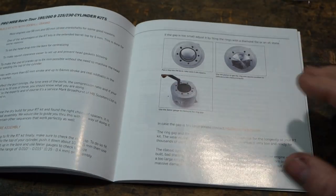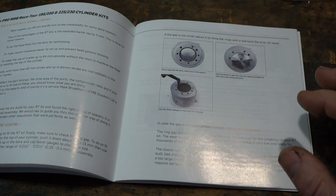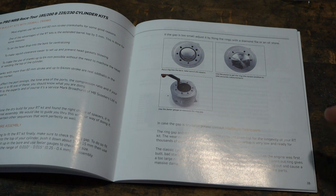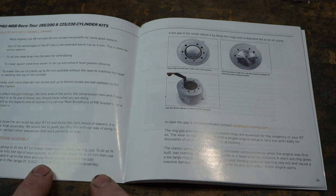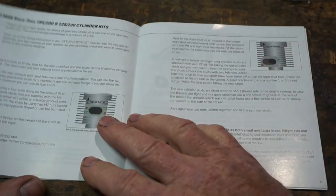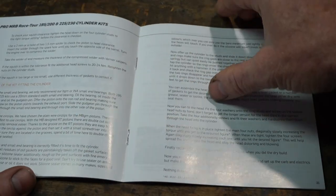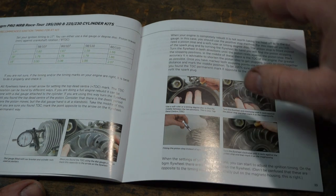There are other explanations for different combinations here — 110mm rod, 60mm stroke with the 107mm rod — all trying to keep the ports as low as possible. And then it comes to a little explanation on how to do your ring gap. Simply put the rings into the bore, push them down so they're square with a piston using the piston to push them in about 10–15mm, and then put your feeler gauges in the gap, checking each ring individually. The gap needs to be between 10 and 15 thou, or 0.25 to 0.4 millimeters on assembly.